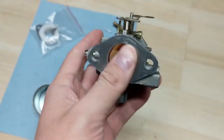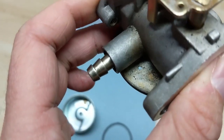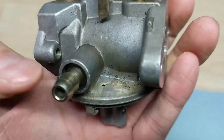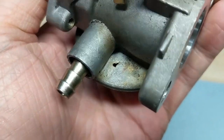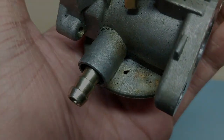But here's the thing. The carburetor looks to be good, but it has that little crack in it. There is no way for the bowl to pressurize, because every time you go to pump air into your primer bulb, it's just going to escape through that hole — which basically makes the primer system non-functional.